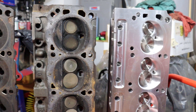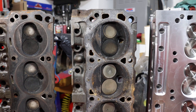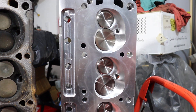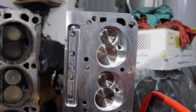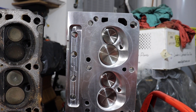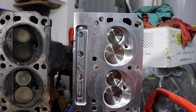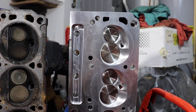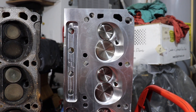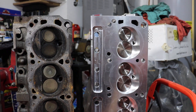On these earlier versions, both were high compression engines. With the 52 cc head it was almost 12 to 1. With the 64 cc head it was somewhere in the 10.8 to 1 range. And with the 72 cc head and the new pistons on the Eagle rotating assembly, it's going to give me right at 10 to 1 compression ratio, which is what I was looking for. This is going to be a street driven engine — I'm going to have to run it on pump gas. Although I could have gained more horsepower by going with a smaller combustion chamber and higher compression, that comes at the cost of street ability.